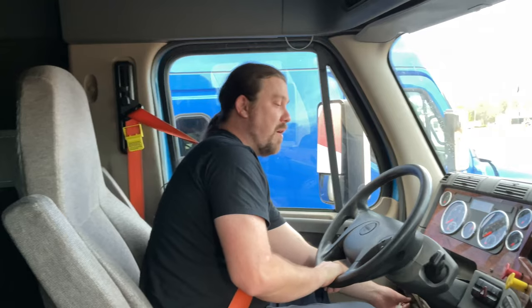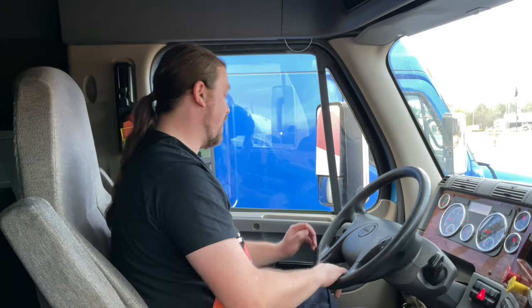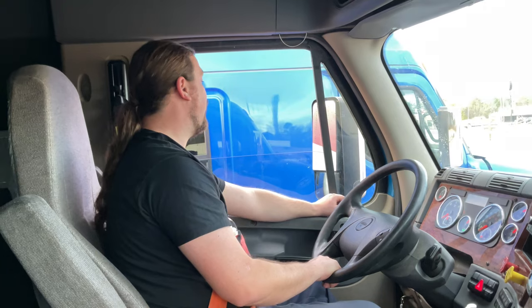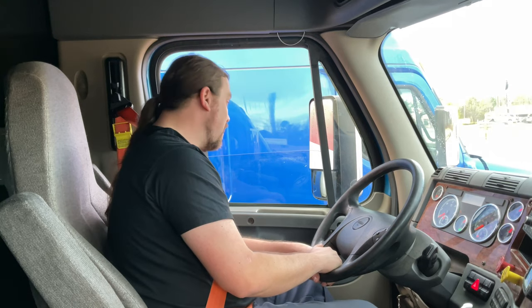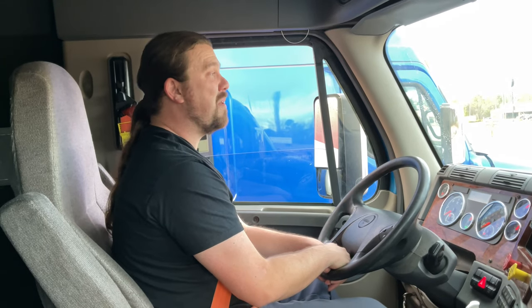I'm gonna turn off my engine. I'm gonna turn my switch back on to resupply power to the gauges. And I'm gonna push in both valves, the red and the yellow valves. I'm gonna roll my window down and listen for air leaks. This gives my gauges time to equalize after the initial pressure drop. No air leaks. Now I'm going to look at my air gauges. I should be losing no more than 3 PSI in 1 minute.